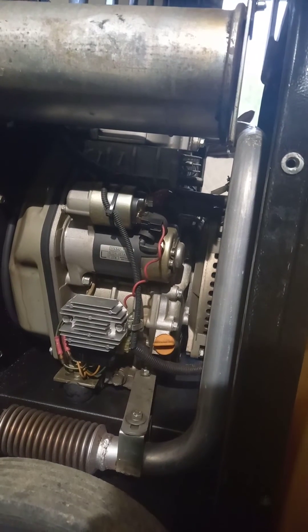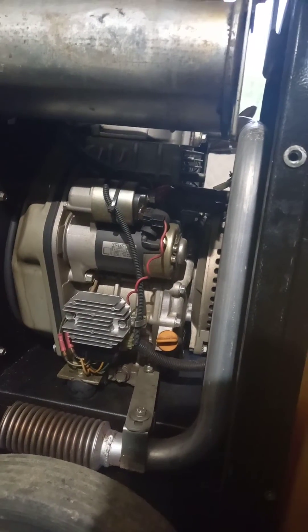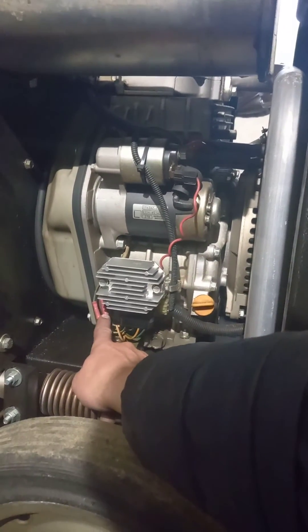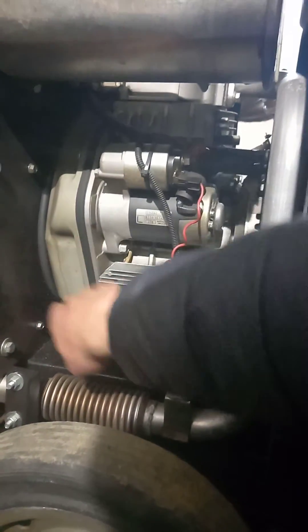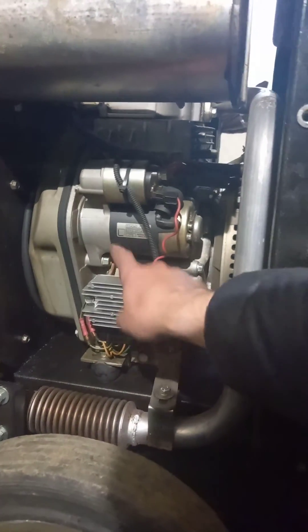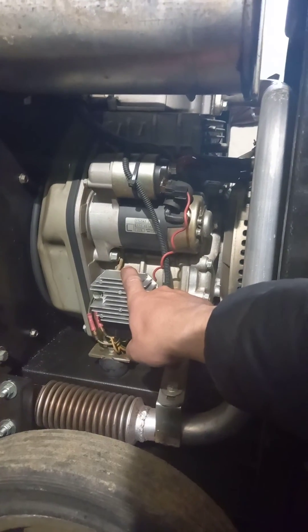So that's how I diagnosed it. You have the red battery light illuminated and then she'll die off after 10 seconds. Check to make sure you're getting voltage coming back from the stator assembly, and then it's going to be highly likely that you've got a failed regulator.